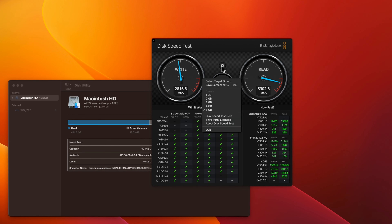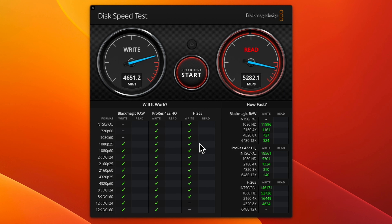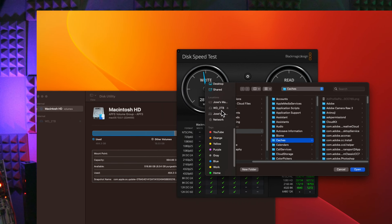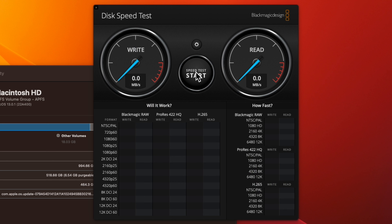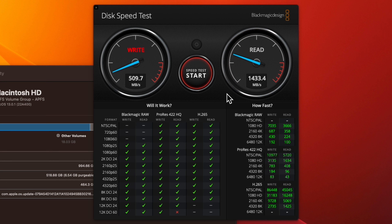Now we're ready to test the speed of our new SSD. I first did a speed test of the internal SSD to get a baseline. My Mac Studio with a 1TB internal SSD averages 4800 MB/s when writing and 5300 MB/s when reading. The SN770 in the Akasis enclosure reaches transfer speeds that averaged about 2700 MB/s for both read and write. The upgraded version, the SN850X, transfers at this same exact speed. This means there is no benefit to choosing the faster NVMe because the Akasis enclosure caps the transfer speed at 2700 MB/s. I searched around a lot and this was the fastest I could find.